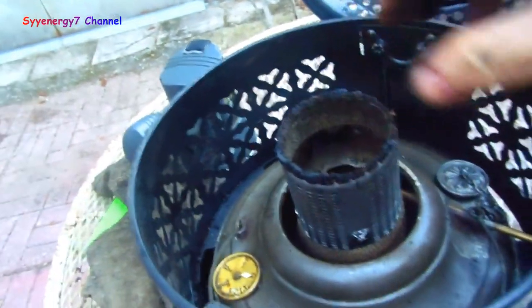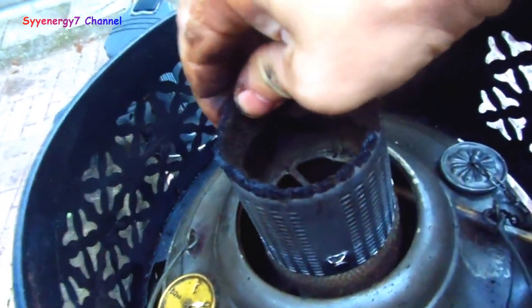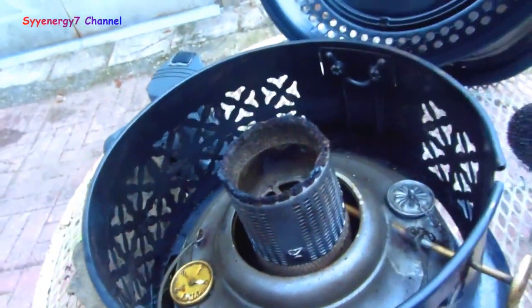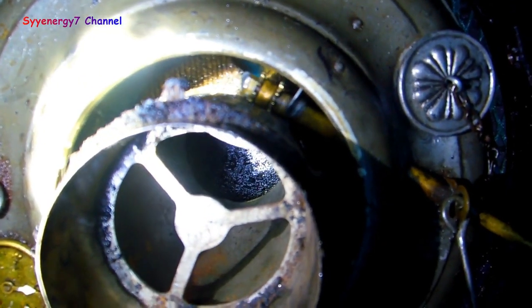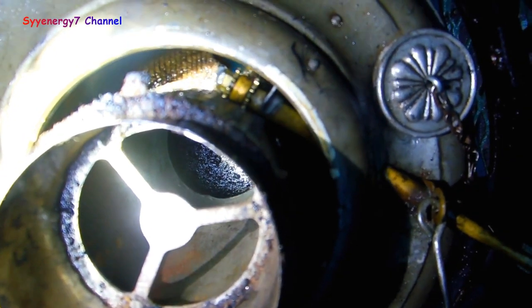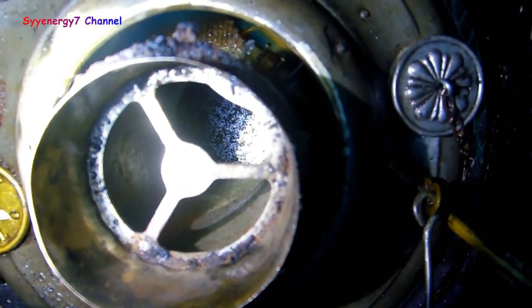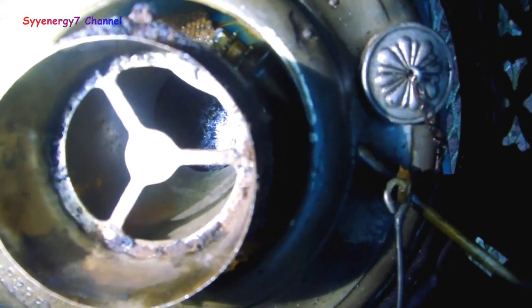To get this thing back on, you don't actually use this part - you've got to press it. Since I pulled up the cotton wick a little more, I need to push it down and get it down and assemble the rest. You have to line up those two wheels on the thing that turns the wick with the slotted edges. Where those wheels go is where the wick is split in half. It's almost time to change it, but I just tried to lift the material a little more since I have a new wick on order.